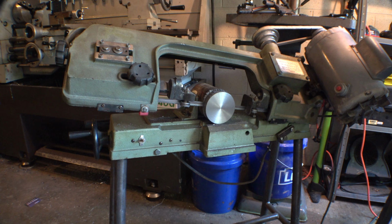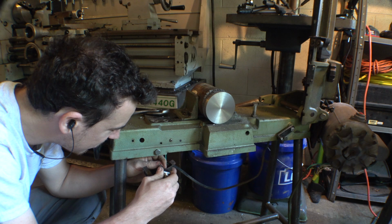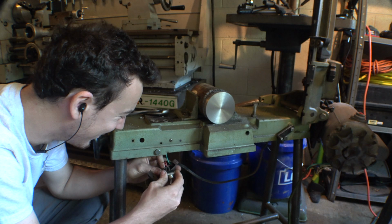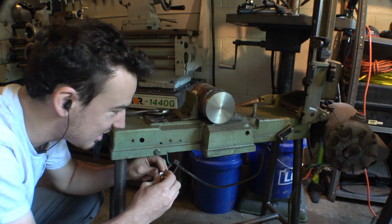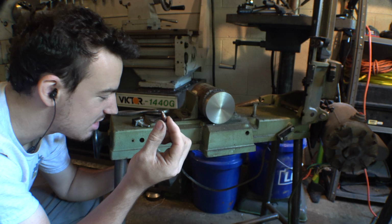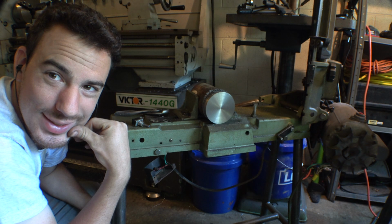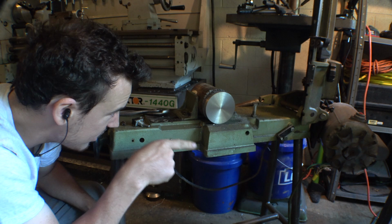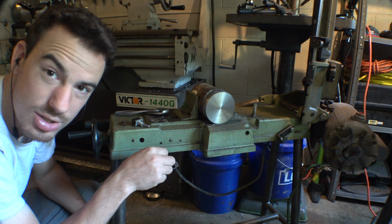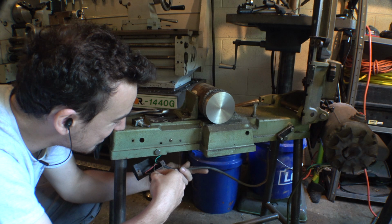The motor still works. I think it's just the on-off switch. Oh, the wires have melted together and have arced. Ooh, there's some burned. Like, this is unplugged, right? Yeah, it's unplugged. There's some burned electronics right here. Ooh, wow. These have melted off. This thing's gotten so hot. It's just melted off. So the way I have this thing wired up, I have these little wires going from the positive of the big wire, going through this small wire to the on-off switch, going back to the motor, and that's what shuts off. So when the motor's on, the current is running through these small wires, heating them up, and causing them to melt.